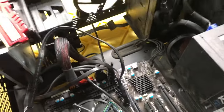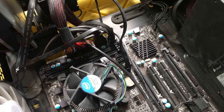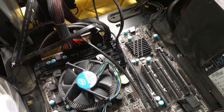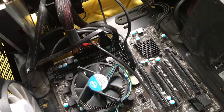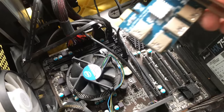I'll show you the drawer next to me in a minute. They came right up and recognized the GPUs. I installed the mining software and had to increase the virtual memory. Based on every GPU you have, you have to up the virtual memory based on the GPU size, otherwise it won't run right. So you just got to know that. But that's through research, you figure it out.